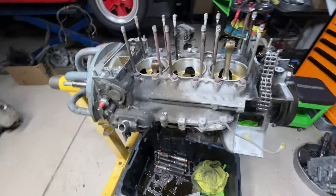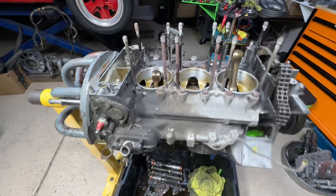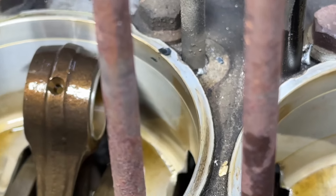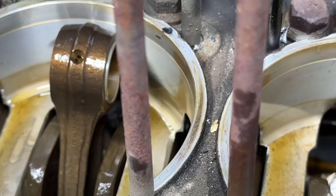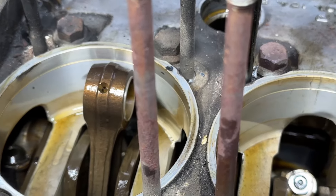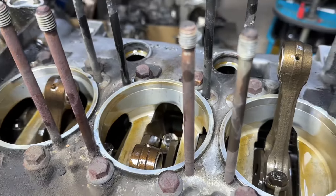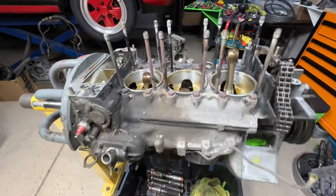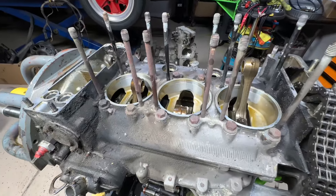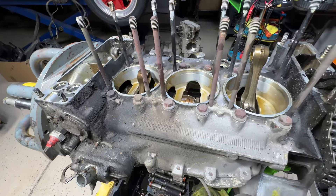These 3.2s are pretty tough. But there was one broken head stud, and you can see these are pretty rusty. So we're going to have to put a new set on here because those are going to break — they're definitely going to break. So we're going to change all those out. Hopefully we don't have any issues removing them. The one on the other side, like I said, one did break.